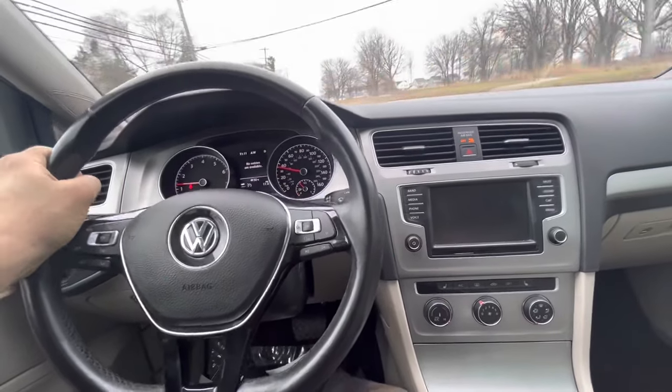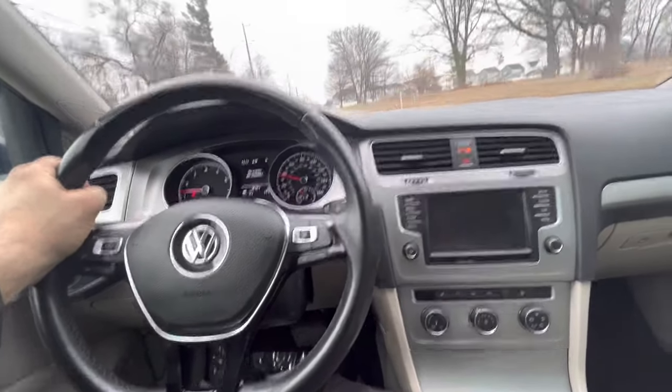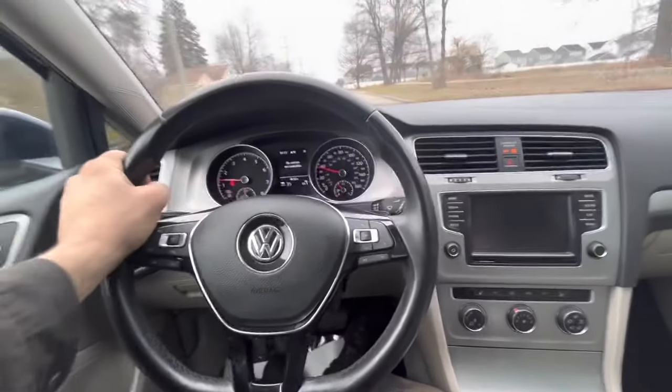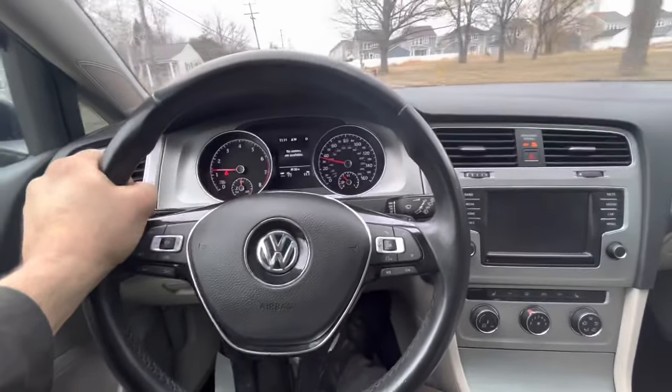This one I already lifted up in the air and looked at it, and it had a cheap aftermarket axle on it. You could feel excessive play in the inner joint. So I'm just showing you how it feels on the road when they fail — it's pretty common.